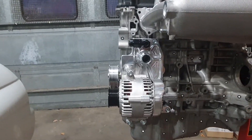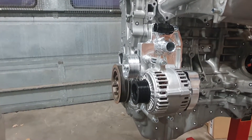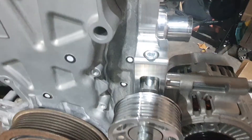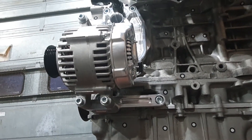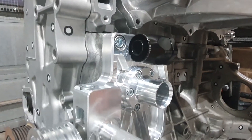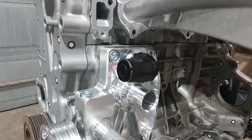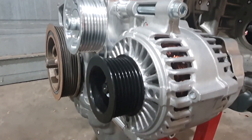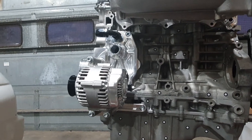We're currently doing the electric water pump kit for K20. We've got our second prototype back from the machine shop. We weren't massively happy with the first one — there were a couple of bits. We wanted to include a little more adjustment on the belt side for the pulley, and also we wanted to make sure that if you were rear wheel drive and using the kit, because of chassis clearance or whatever, you could still 90-degree off the 32mm outlet. We've also got AN16 adapters if you're running AN line. It also pulls the alternator down a little, which is going to be quite useful. So we just need to get a belt length sorted and then that should be good to go — only a couple of weeks away.